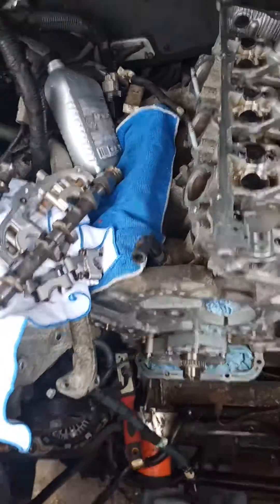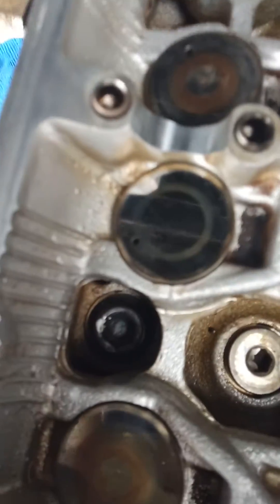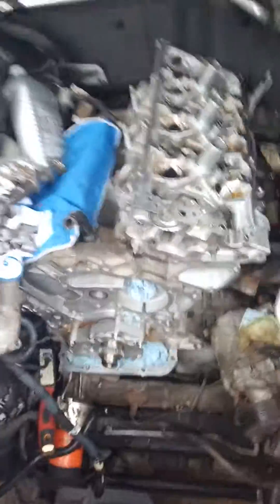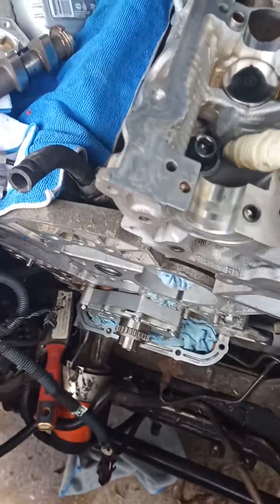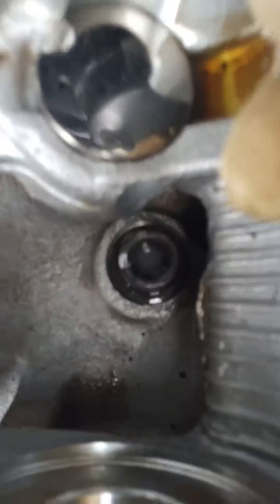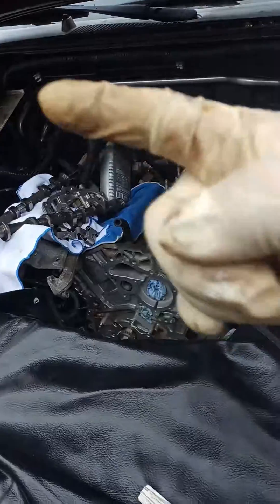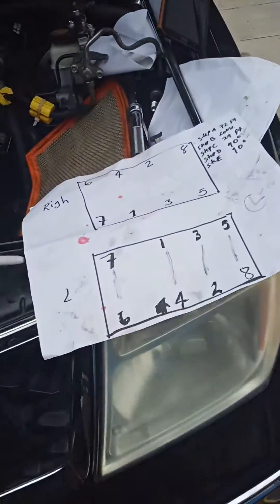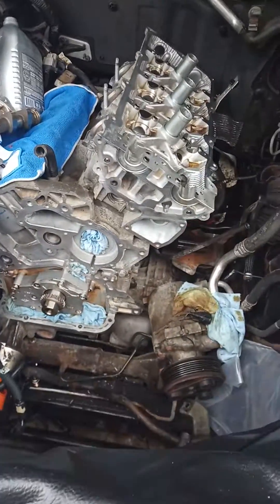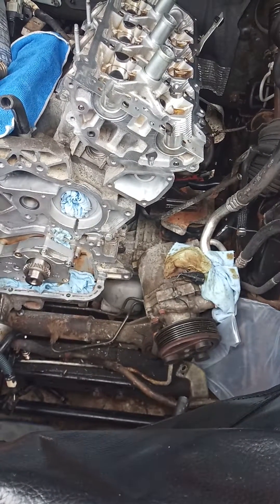When you finish, all the bolt marks will be facing you like this. I'd recheck your marks - as you can see on my head right there, you can see the mark, the mark, the mark - they're all facing that same direction. I marked each bolt in the middle, did my first 90 degrees to face me, then another 90 degrees, and now they all face toward the middle of the cylinder head. Hope you liked this video, give me a thumbs up, have a nice day and God bless.